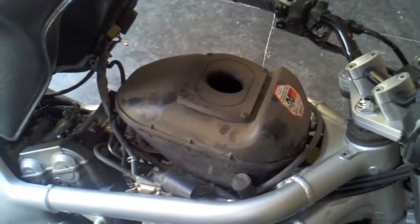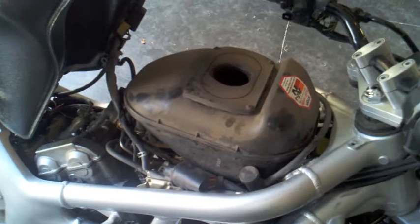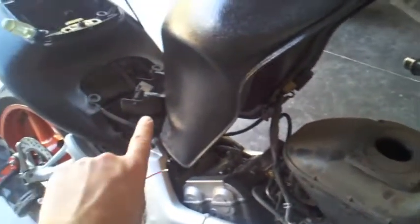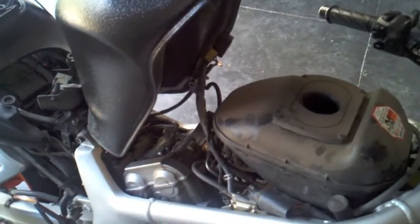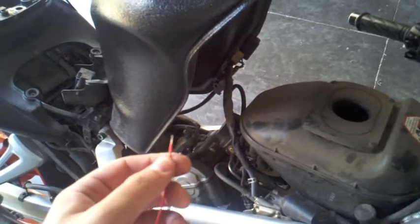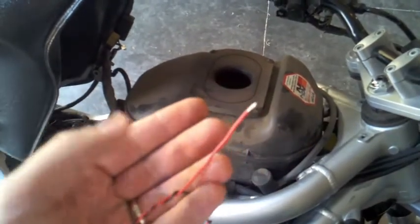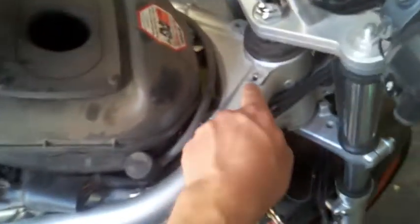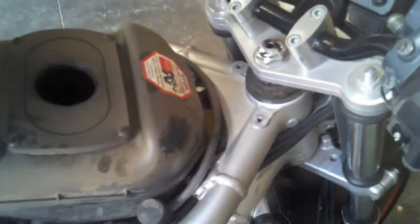What I'm going to do is use a little switch and tie in these LED strings from the switch, so the battery will go from battery to the switch on this side over here. Then it'll go into the resistor, then into our LED strings. The other end of the LED string is black, meaning it's negative — it's the ground. We're going to tie it in right here up to the frame.